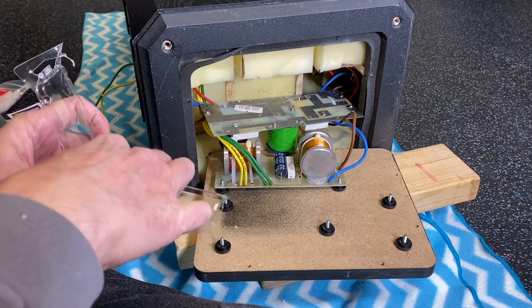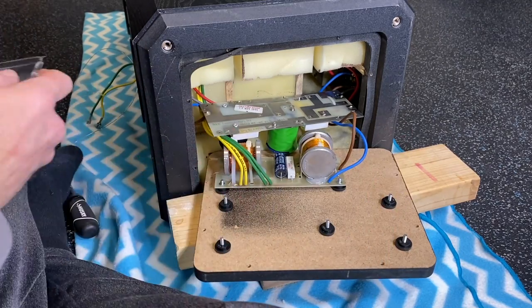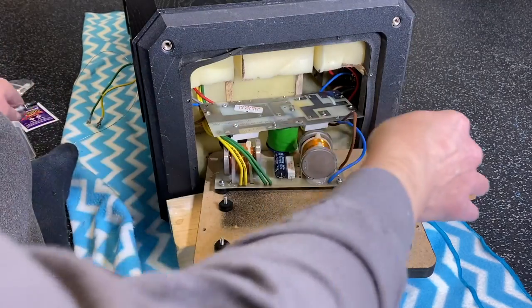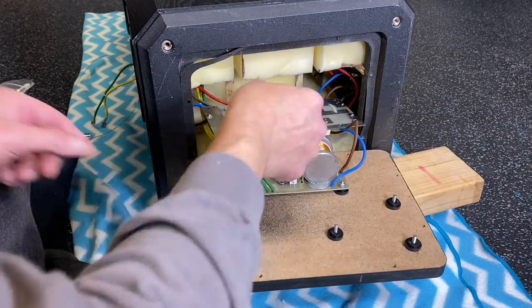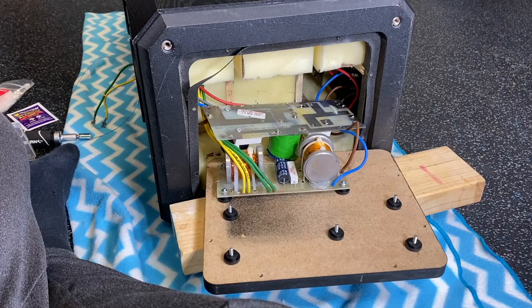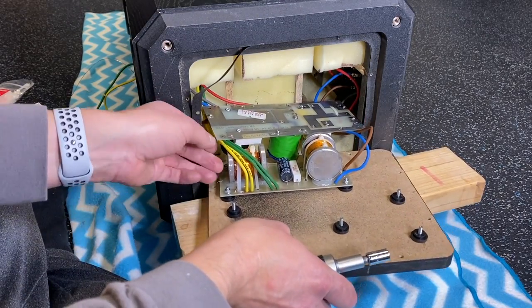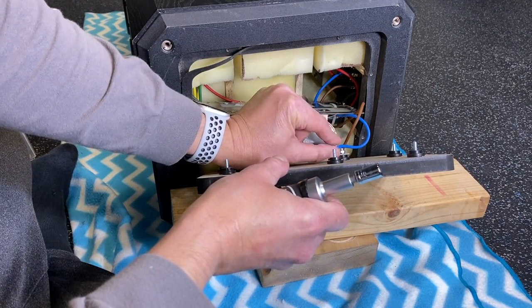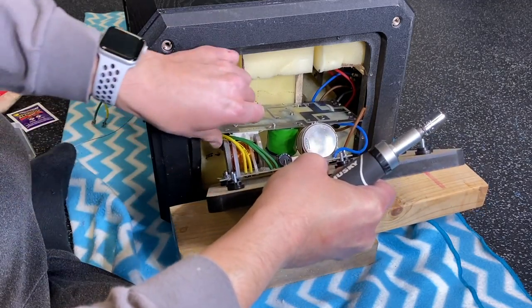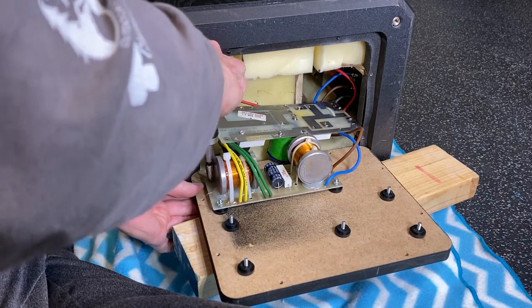Okay, I'm going to use some 4mm lock washers. Just loosely until I can get all four of them in there. This one in the back corner. All right, cinch those up. And I'm hoping this works well. I don't see why it shouldn't. A nice thing about using the washer is it gives a little compression and spring to really keep that nut in position. In addition, the lock washer should really keep that from moving around. Let me see if I can just get this driver in there. Just enough to compress those washers a little bit.